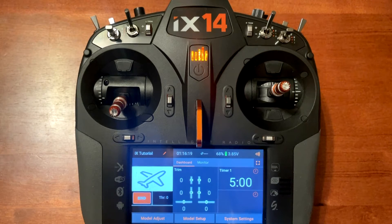Two things we need to be aware of when putting the custom image on our micro SD card. First, you need to resize the file to 266 by 164 in JPEG format. Second, the file needs to go in the base folder on the SD card. Simply put the SD card in your computer, open the SD card where you see the files, and put it at the bottom — not in any folder, just by itself.